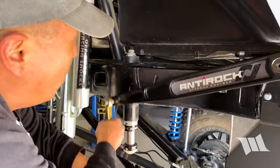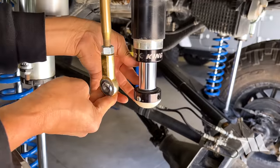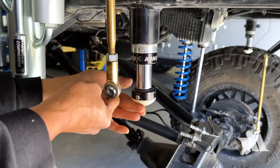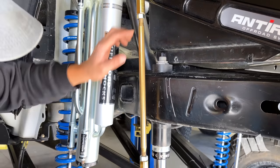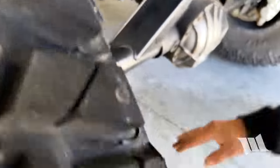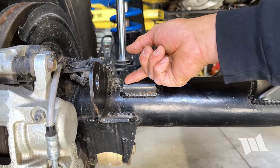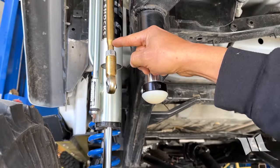At full bump, you can see this bump stop has two inches of travel and about an inch and a quarter additional for the pad. I can even shorten up these links maybe about half an inch on either end — shortening this link up an inch total. After measuring it out from this link point to the pad, there's an inch and a half distance. So we're just about there, and I think if I can take out some space from these links, it should make it.